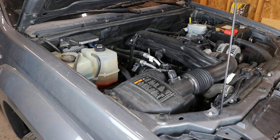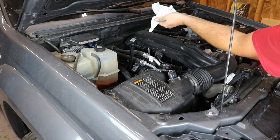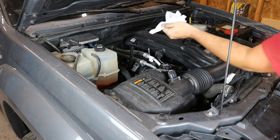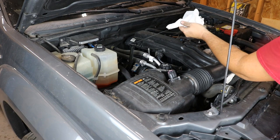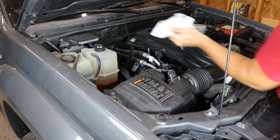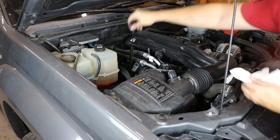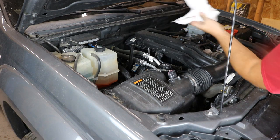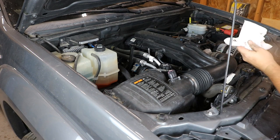Keep adding a little fluid at a time and check the level until you get it between the hash marks. This truck took just a hair over a gallon after all of that. After taking it on a drive for 10 to 20 miles, check the fluid one more time — or check it the next day. You really don't want to run around with a low fluid level in a 4L60E because it will most certainly self-destruct.